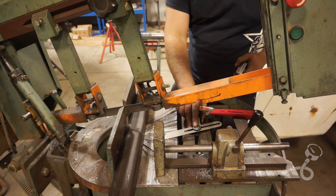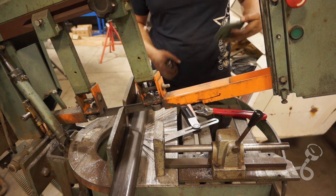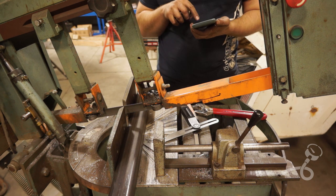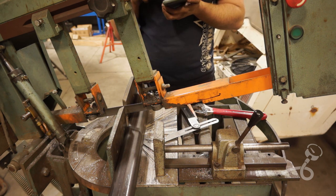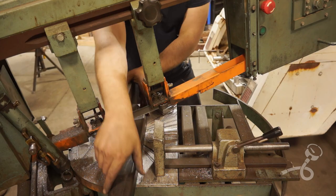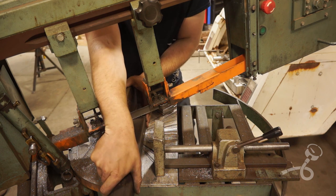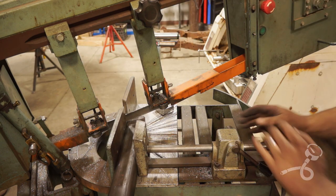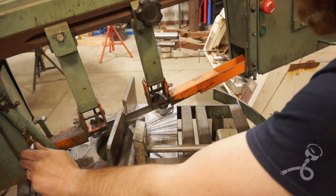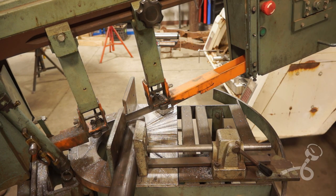All right, so what I've done, because I don't have any real documents for this, like DXF files for the plasma cutter, I just saved the drawings on my phone, just pictures of the drawings. Like a 24.2 degree angle is what we're shooting for. Okay, so I'm gonna cut right here. That cuts just a sliver off the tube. Okay, so what we do is we start it, and then we just crack this open a little bit, and then it just cuts down that real nicely.